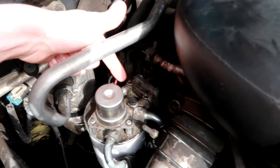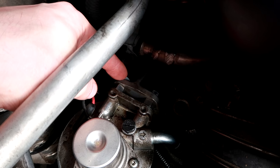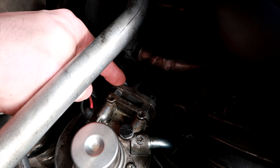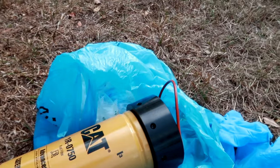Here's what I've already done: I've put in these makeshift spacers — I just took two nuts and put them in between the fuel head unit and the bracket it's supposed to be hooked up to. That allows me to fit this bulkier filter in the spot where the original one goes. I just have to make one modification to the fuel head unit so the new one will work. I tried to do this up north but I was running low on patience because I didn't do research, which caused the vehicle to start but then die because I didn't remove a spring and a ball — I have to remove the spring and a ball.